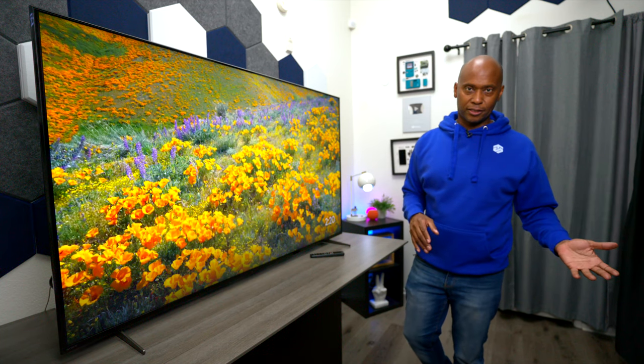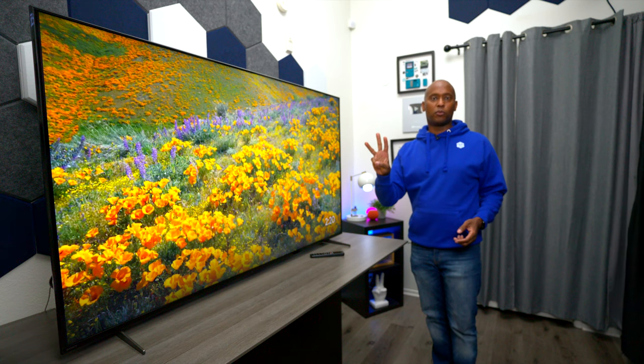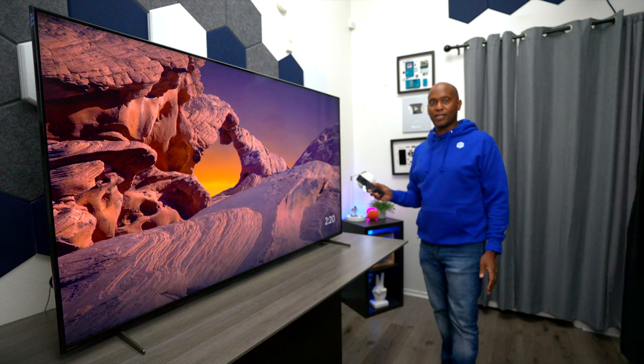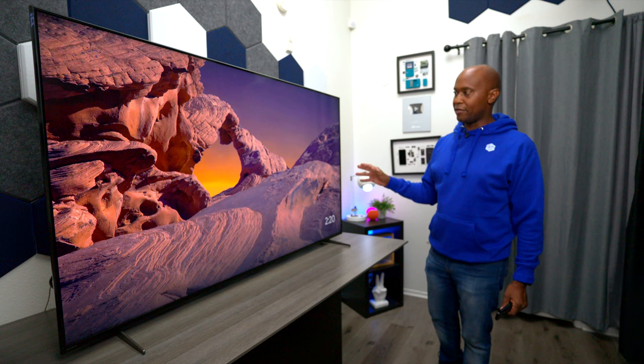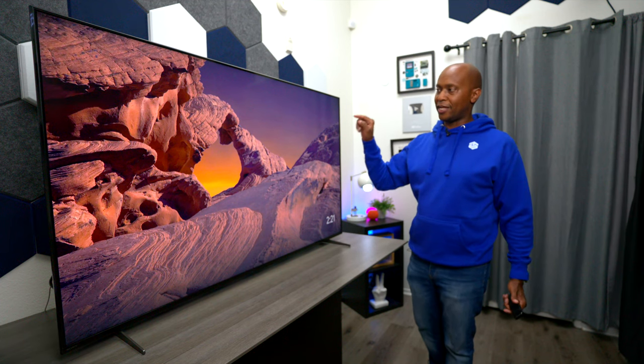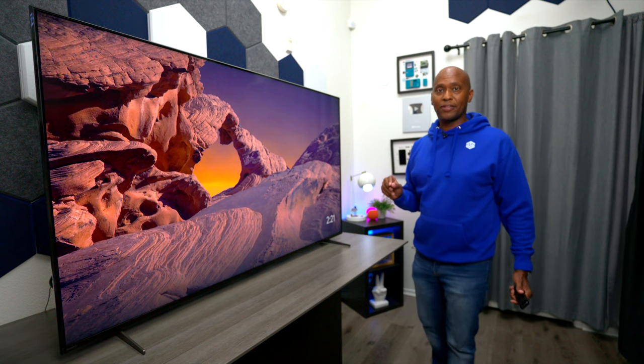Here are my first impressions. Starting with the cons: I wish this TV had at least three HDMI 2.1s — you'd use two for gaming consoles like Xbox Series X and PS5, and a separate one for eARC for your soundbar. If you have both gaming consoles and want max performance without plugging in and out, you'll need a switcher or run one console at 60fps. Also, at this price level you'd expect a backlit remote control. On the pros side, I like this design better than the X80K and X85K — it's built with better material, less plasticky on the front, and the legs are very sturdy. One thing a lot of people don't know is this is a true 10-bit panel, where the X80K and X85K are 8-bit panels with two bits of frame rate control. So this is the real deal.